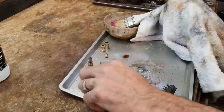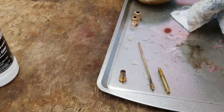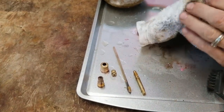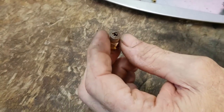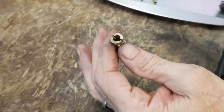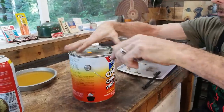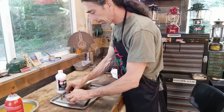Although vinegar is a very tame and safe cleaner, it is an acid. If you leave it on nickel-plated parts or on painted stuff, it's going to get to it and you're going to ruin it. With brass, the only thing you have to worry about with vinegar is the pink color. Now the check valve — I did soak it. This one is leaking pretty bad and it may not work. Usually with the check valve I just recommend that you replace it. What I'm going to do now is drop this in a bucket of carburetor parts cleaner and just let it soak for a few days.